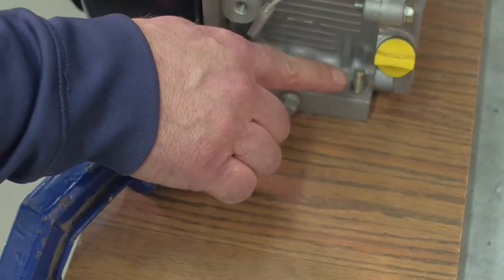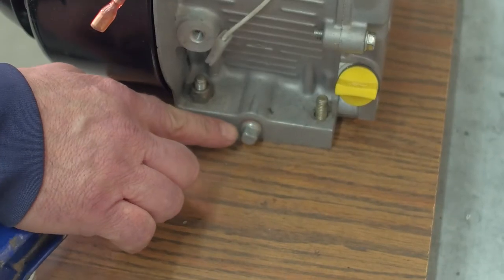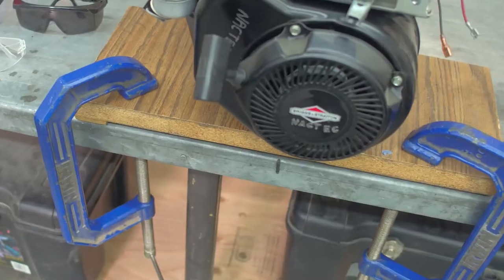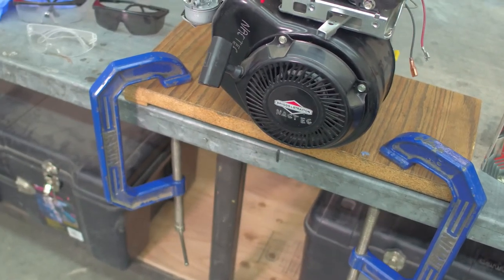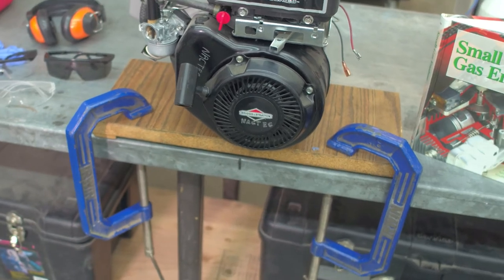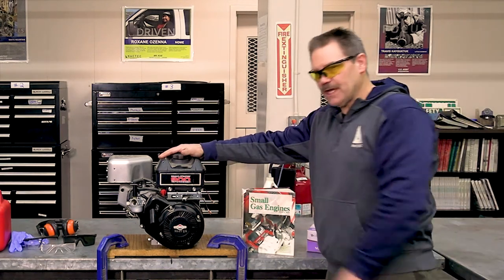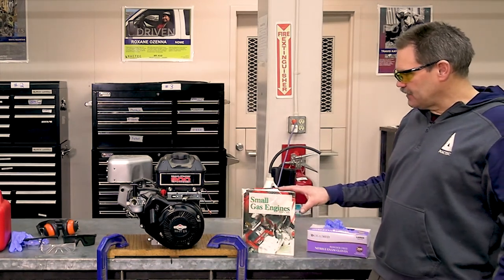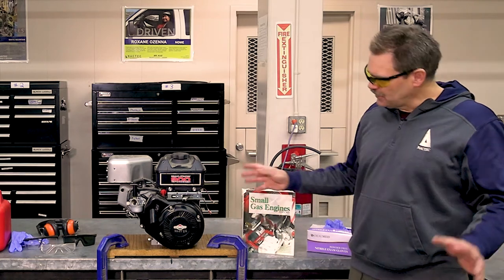The little plug is right here and you can just let it drain out. If you get the right fitting with a barb, you can put a hose on it and have it drip into a pan. Notice that the engine is bolted to a board with quarter-inch or 5/16ths bolts — they come up from the bottom of the board and fasten the engine to the board. Notice the big C-clamps to hold it down. There's no way you're going to start this engine and hold it to the tabletop — it's just going to vibrate and end up on your feet. This makes it very safe. The engines will be supplied with the board when they go to site. You need to secure the engine when you go to start it.